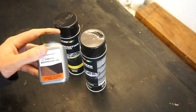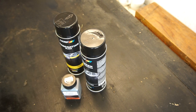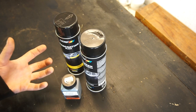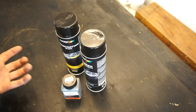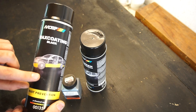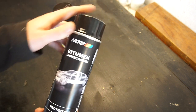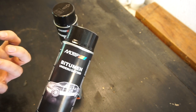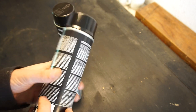For killing old rust, anywhere I find surface rust I'll clean the area and use a rust converter. They usually work by brushing them on and leaving them for a few hours or a day depending on the brand — they turn bluish or black, killing all the bacteria and stopping the rust from spreading. However, especially around areas that get stone chips from the tires, this can wear away. So you want a coating on top — a rubberized undercoating that stays soft, not one that gets hard and cracks when it gets a rock chip.